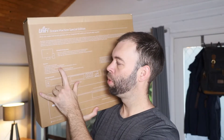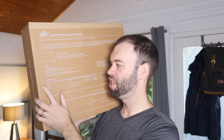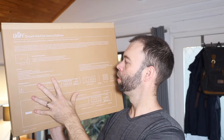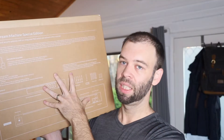Six of those ports are 802.3af Power over Ethernet supporting 15.4 watt devices, and two are 802.3at PoE+ supporting 30 watts per device — doubling the power to run more power-hungry devices. There's also one 10 gig SFP LAN port, a 1.3 inch LCM color touchscreen, customizable internet threat filtration and traffic identification for enhanced network security, quick Bluetooth-powered setup, one rack unit size rack-mountable, and compatibility with the smart power redundant power supply system.